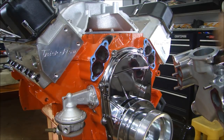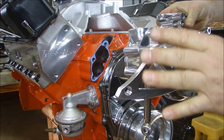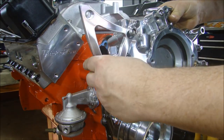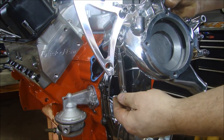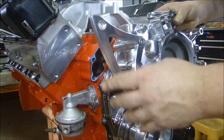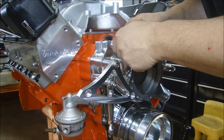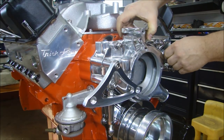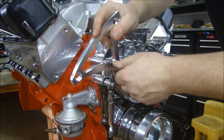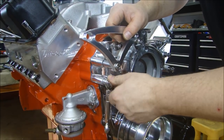I have a little tip for you. Before you put the whole thing together — before you put your sealant on the gaskets and bolt it together for good — it's a good idea to mock it all up to find out where all the brackets go and where the bolts go for all your hold downs. For my serpentine belt I need this pulley holder and this custom bracket. Those bolts go through the water pump housing here. So if you mock it up and put it together, when you assemble it, you don't have to take any of the bolts out.